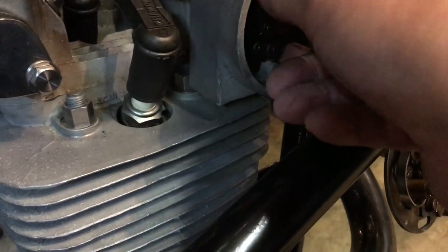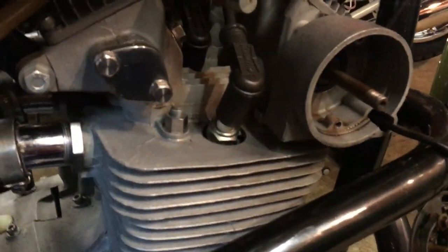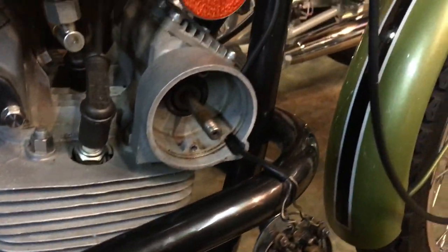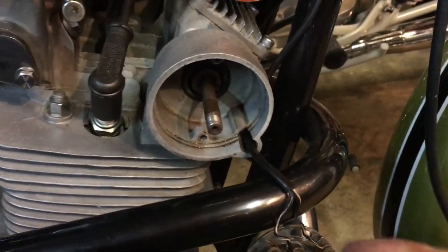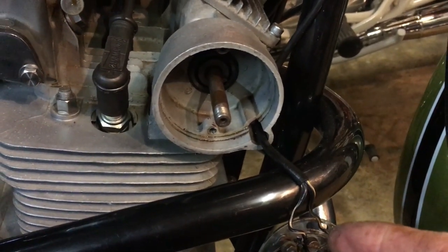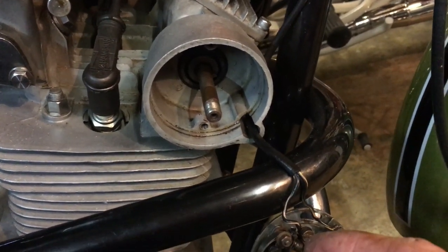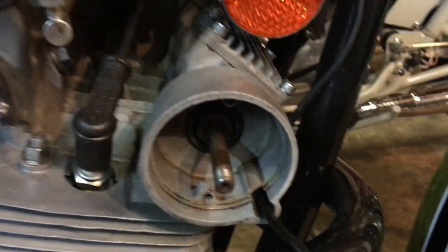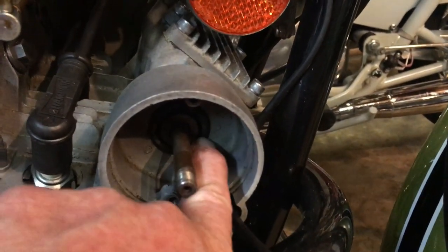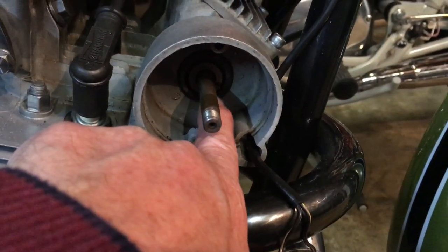I might have to just turn the motor over a little. Right, let's turn the motor over a little so we can get that peg in a different position. Sorry, I had to turn you off there because this is a left-hand kickstart. So this is going to make it even more interesting trying to position the crank with a kickstart. Oh, I could use the back wheel actually with it in gear to get the timing locating pin in. But anyway, I've turned the motor over so the pin's now rotated, I don't know, about 30, 40 degrees